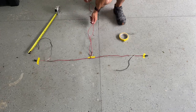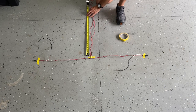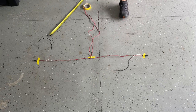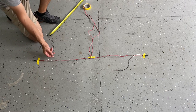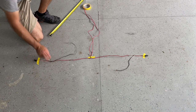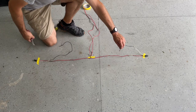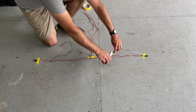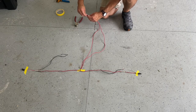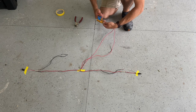We need roughly 20 to 24 inches to the front, which puts us about 28 inches up at the front. So this is the rough shape of the harness. The connections they had on here before actually aren't that bad - they used sealed solder connectors to make these junctions, not just crimp connectors, so they did a really good job at this part. Where they severely messed up was wrapping a bare wire around a screw - that's just not going to cut it.